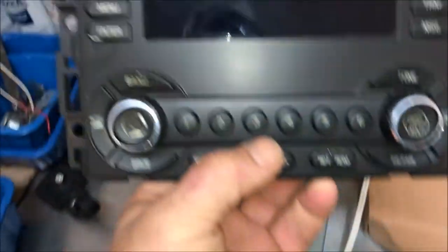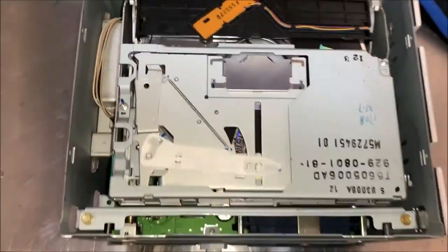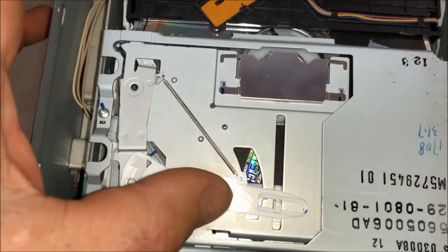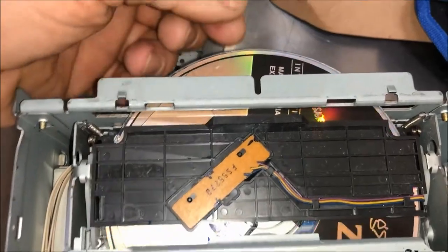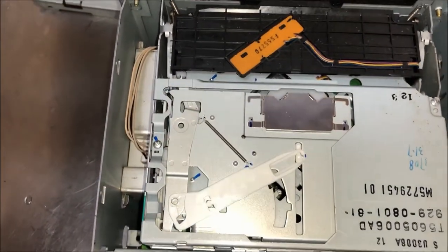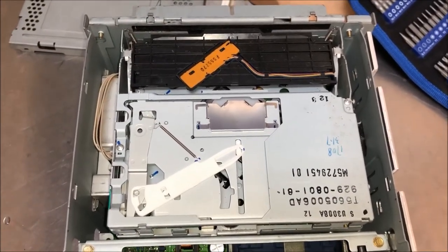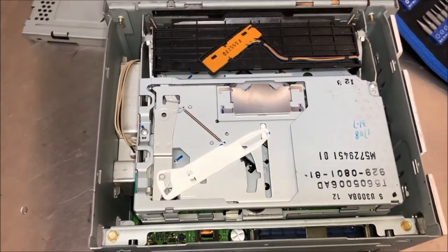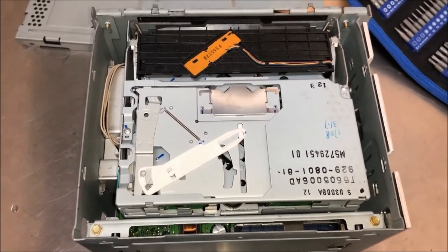After releasing this top panel you just lift it out of the way, put it aside, and now you can see the CD mechanism. The CD slot is at the very top of the front panel, which makes it easy in this particular case to get to the CD mechanism and retrieve your CD if it's not ejecting. All you've got to do is push the ejection mechanism and your CD comes out nicely. Obviously reassembly is the reverse. If it's not working you might want to try some CRC cleaner. The owner doesn't care about this unit — he's already put an updated unit in his car — all he wanted was the CD back.